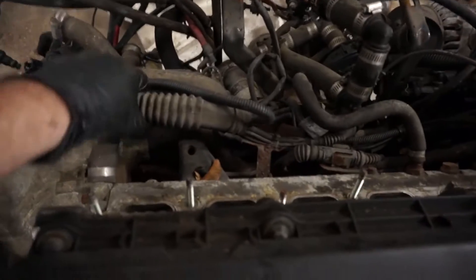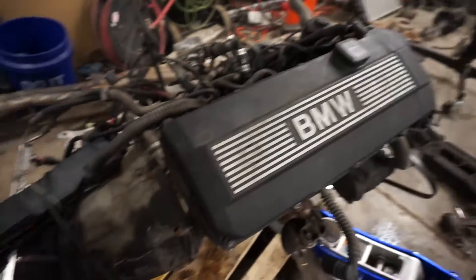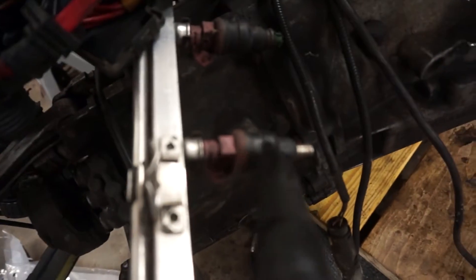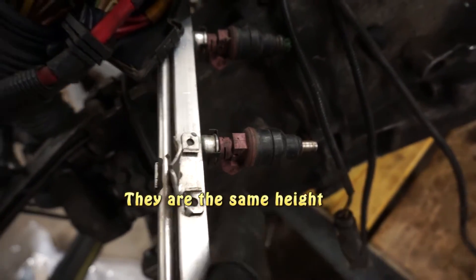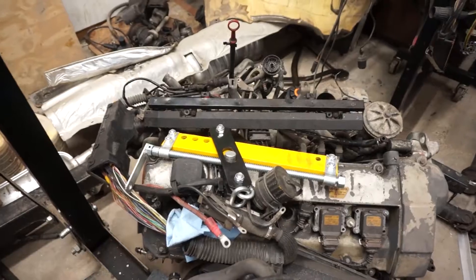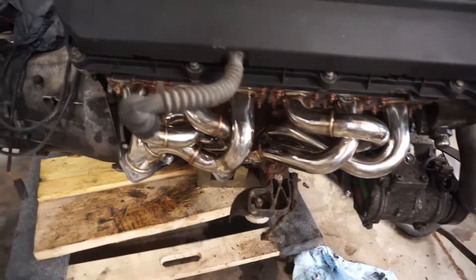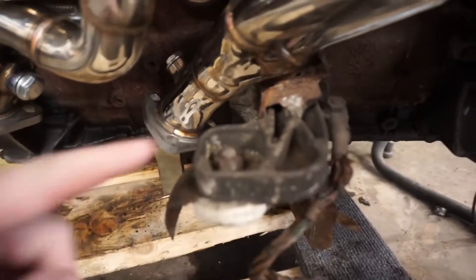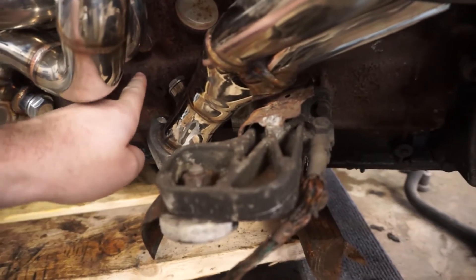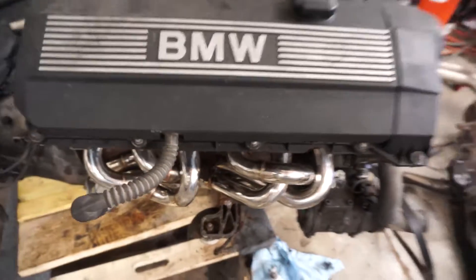The other thing I was checking under here is to see what I needed to order — definitely these heater hoses in the back and I think the throttle body heater hoses as well. The last thing I want to do is see if these injectors are the same size as M50 injectors. If they are, I can swap the M50 fuel rail over, which I conveniently have over here, and pull the entire fuel rail assembly off of this. The headers are on. One thing to note is the O2 sensor on the first bank will not clear — it runs into the drain plug back here, it's too long, so I want to relocate that. But we're making progress.